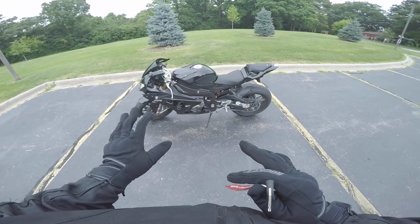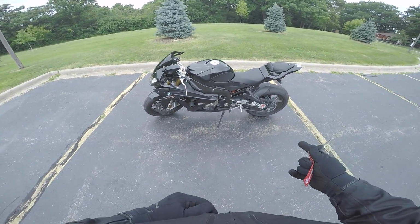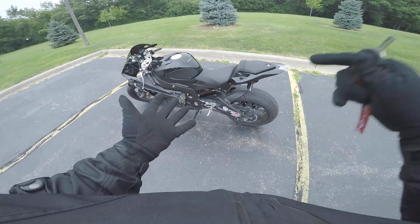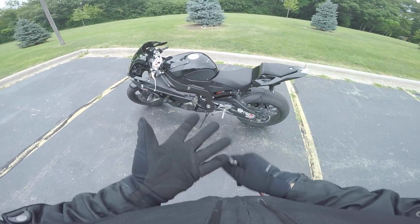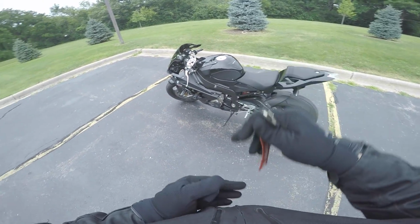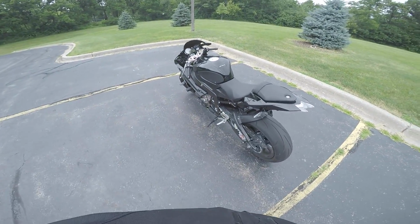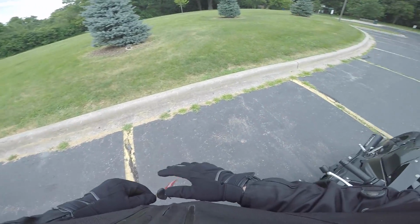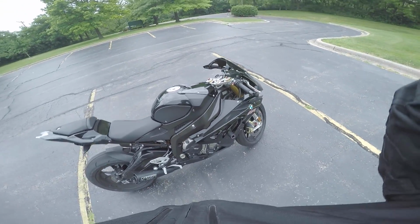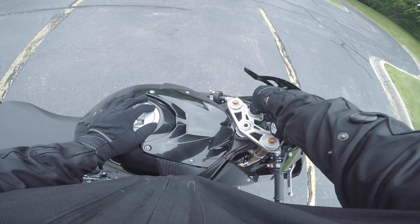Anyhow, then if you choose, you could go to a dyno, have them dyno the bike, give them the air fuel ratios, and then they can adjust the maps for you as well. Now the nice thing about BrenTune, especially with the remote tuner, is I can return the bike to stock with the stock map. I could put the 93 pump octane tuning map on there, and then I also have a race map for MR12 race fuel, which I got to build some money up for, because MR12 is not a cheap race fuel. Just like 650 Ebe calls it, I'll call it savage mode for this bike as well. Even though 650 Ebe's H2 is way more savage than this thing ever will be, unless I get a full $20,000 race motor in it.